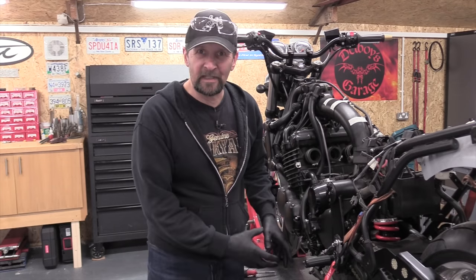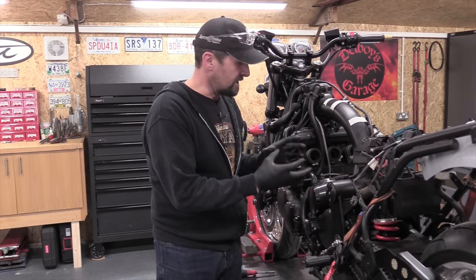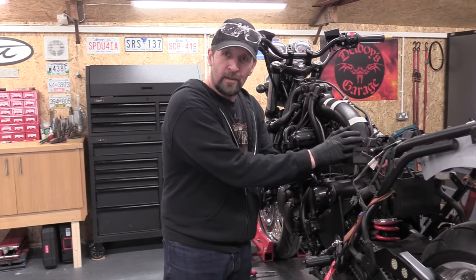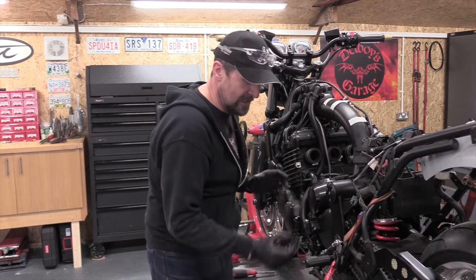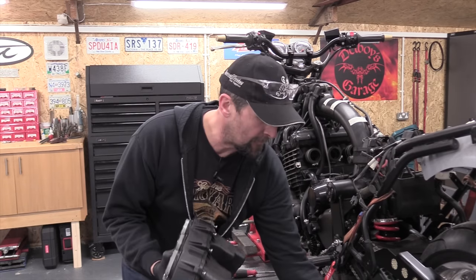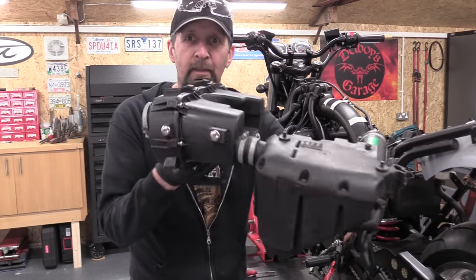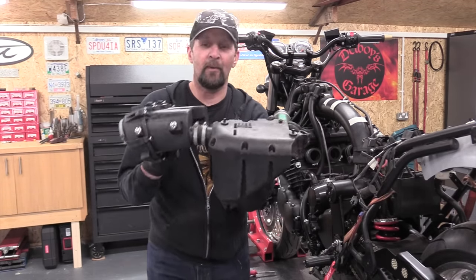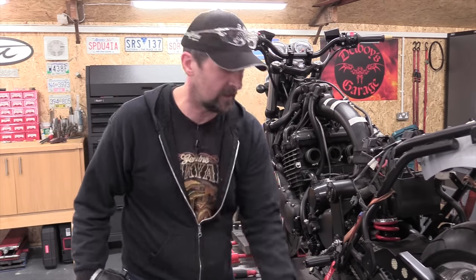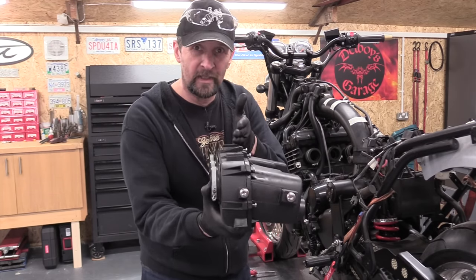The reason they get left is very common. If you've read a Thunderbird, Adventurer, any of those derivatives of this engine setup, well, this frame is the reason. The way this is laid out means that your airbox is a two-piece affair. You've got this kind of big plenum area at the back. They fit together like that. That's the whole assembly. And because of that, you take that bit off, that's just a leaf collector. Get that out of the way. Now, what's left, you put your panel filter in that point there.